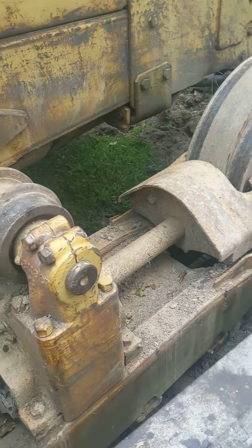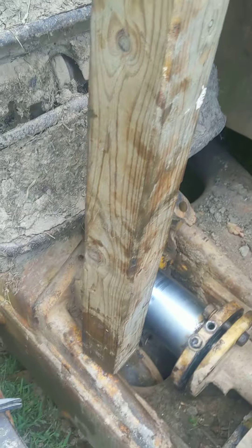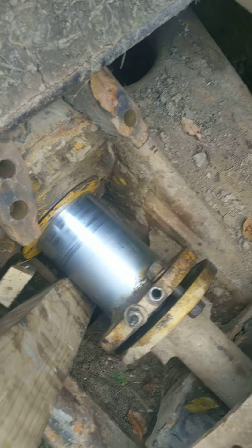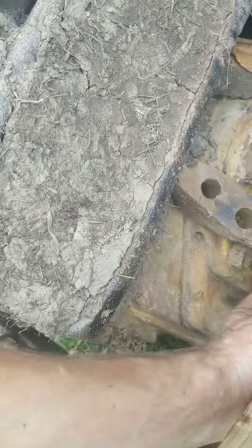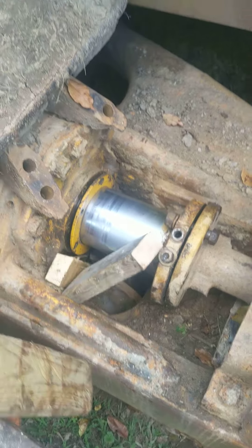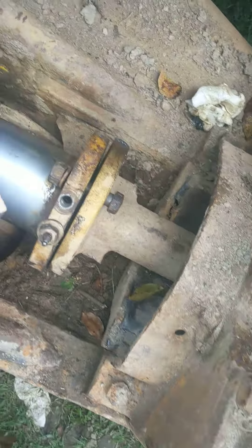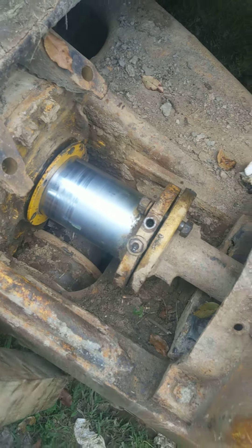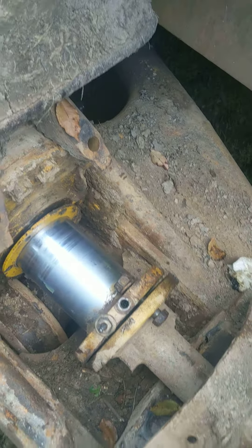So I've got the adjuster piston in there in the sleeve, in the hydraulic cylinder sleeve. I used a 4x4 and some blocks — put some blocks right in there, kind of doubled them up, and used those to push and bring these together. That really, really helped. Also, when they were spread apart, I put the 4x4 in between them and used it to push the piston back inside the cylinder.